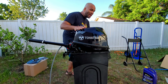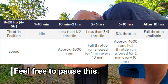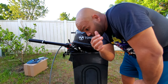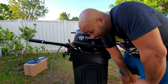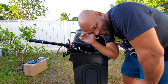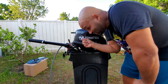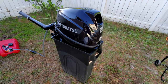The instructions say I need to follow a break-in period. Right now I've got to let it run like this for about 10 minutes. Then over the next couple of weeks I'm gonna take it to the water for the first time. I'm aiming for at least two hours on the first outing, but I'll only be running at about a quarter throttle as the instructions say — so not going very fast, but I'll be taking it to the water very soon.